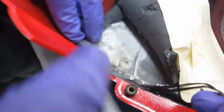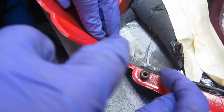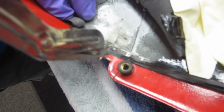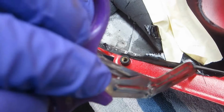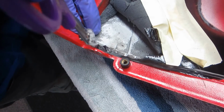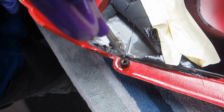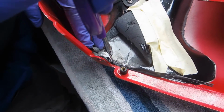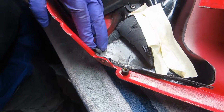The first thing on this repair, we put one strip of unidirectional carbon fiber bridging the crack before we put in the patch. That'll keep it from spreading, because these cracks start at the edge. So here's the crack itself. Let's follow that path. This is the crack coming up this way into the fairing. It didn't start down here, it started up here. So if we don't repair this up here, you're toast. You're going to continue to have issues.